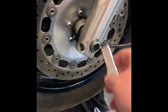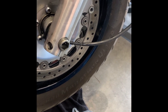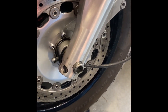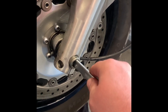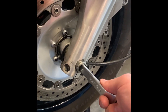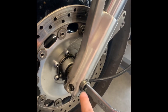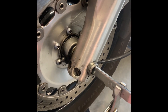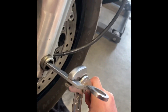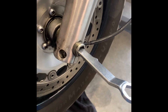Next we're going to pull out the axle. That's actually a 17 millimeter hex key — or allen key. I don't happen to have one handy but I have this piece that fits in there perfectly, so I'll use that. There are no threads in here but as you twist it counterclockwise it'll slowly start to come out. I've only turned it about once and you can already see it starting to come out.